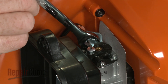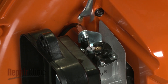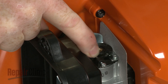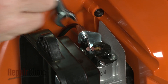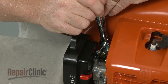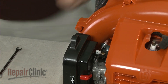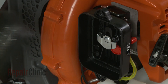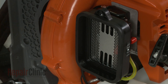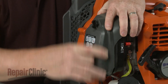If the cable tension needs to be adjusted, loosen the locking nut, then rotate the tensioner to increase or decrease the tension. The throttle plate should be in contact with the adjustment screw. With the tension set, tighten the locking nut. Secure the cable with the locking cap and replace the throttle control cover. Reposition the air filter gasket in the housing and realign the air filter in the gasket. Replace the cover and thread the screws to secure.